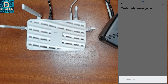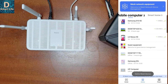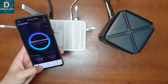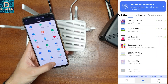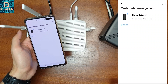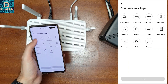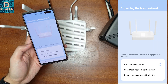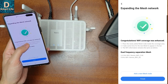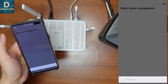To remove and re-add the child node, the child router must first be reset. You can do this from the app. To set up mesh networking via the app, go to the AX1800 plugins interface and find 'Add Mesh Node,' or go to Device menu, then Mesh Networking Equipment and click Add. The app will search for and find the Redmi router. Select the location, and it will configure the mesh networking system. Once complete, the internet indicator turns blue confirming Wi-Fi coverage has been enhanced.